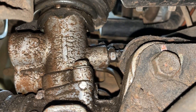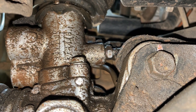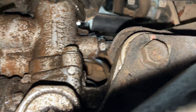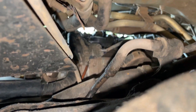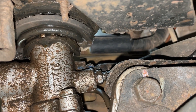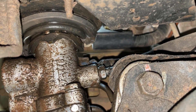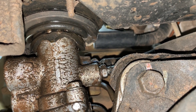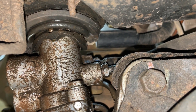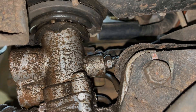It is pretty tight, but that fitting right there — that nut you can see kind of center — is the fitting I need to get out. And to me, it looks like I'm going to be able to get to it. I know one of the hard parts is getting the new one back in. I do remember when I replaced this rack and pinion recently, getting that fitting dead center was a challenge. But we're going to give it a shot today.